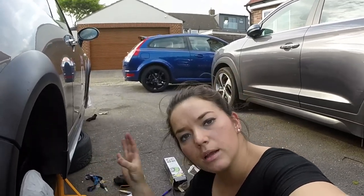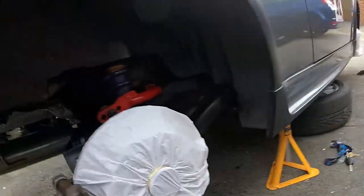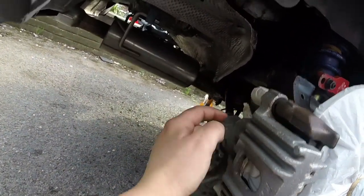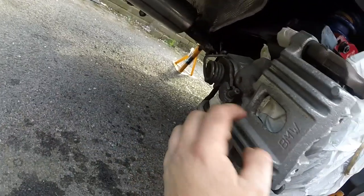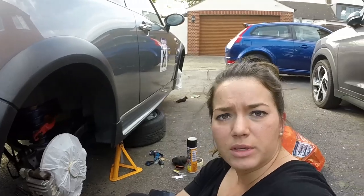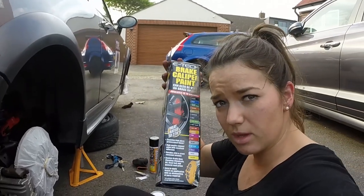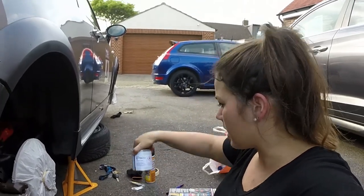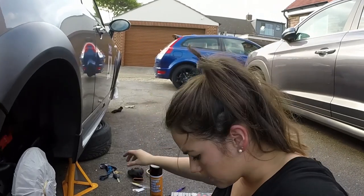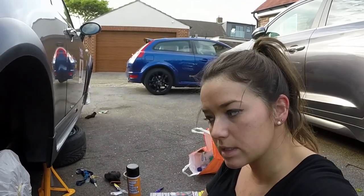I've masked up the rear caliper. I'm not going to do the front ones because I need to do so much more to get that paint off - I'm going to paint the rears for now because they're pretty much good to go. I've masked up everything possible - all the brake discs, anywhere near the pads, the little seals, the bleed nipple, any rubber parts. I've also taken the brake retaining clip off. I've purchased E-Tech caliper paint in red, recommended by a few people. It comes with a pot of caliper paint, a brake and clutch cleaner, and a brush. Let's see how this caliper paint goes.